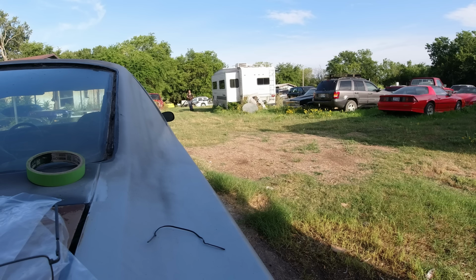Okay, used the scooter, went over, picked up two tires. And now the problem with this door, these bushings and pins are shot. They're pretty bad. So, originally I was going to just take the fender off and bolt it in with that, but we'll have to see how the hinges are on this one. I believe O'Reilly's and AutoZone sell them pins and bushings. I usually order them off eBay, but if they got the ones I need, we may just rebuild the ones that are on it.